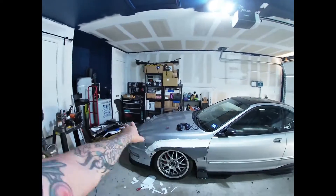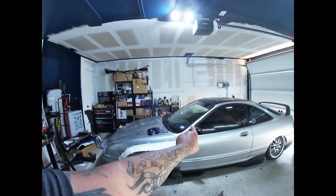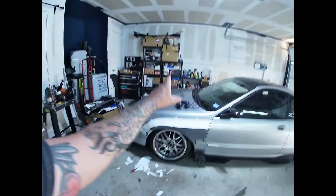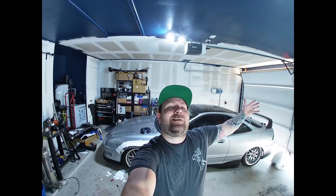I'm not looking for high horsepower numbers. I'm only trying to get roughly 350 to 400 wheel horsepower in a car that weighs about 2,800 pounds — very fun, just something fun but reliable. We are doing a 50 trim T3/T4 turbo onto it, ram manifolds, 40 millimeter wastegate — or 38, I can't remember which one — but it's going to look aggressive, it's going to be fast, it's going to be fun, it's going to be reliable, and it's going to be built by me... the myth, the legend — Rufio.